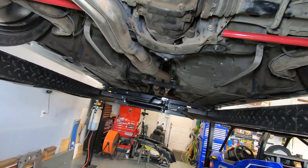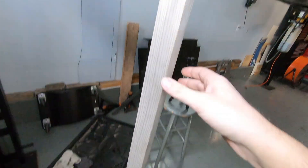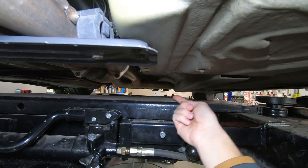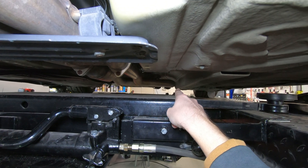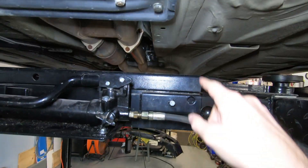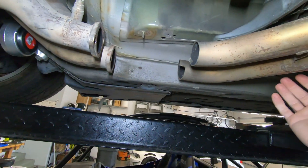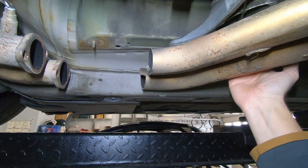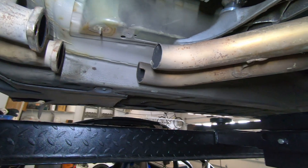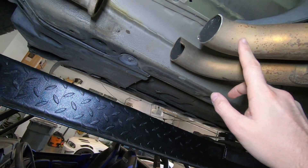This was simple but it wasn't easy, because this is so heavy back here that I ended up using a piece of wood — I got the muffler where I wanted it and then lowered the car down on top of it. You can just barely make out the bottom of those flanges, which means our exhaust is too high. I'm hoping that when we get this sitting where it needs to sit, get the pieces in there and weld it, that it'll bring this down just enough. The only thing that makes me nervous is that this bend starts really soon, but it shouldn't be a problem.